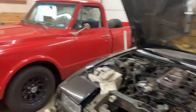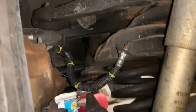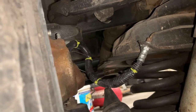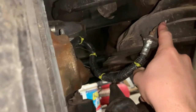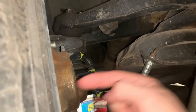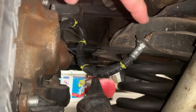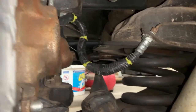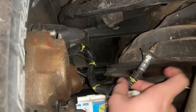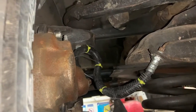It's been months at this point since the last clip with the brake lines, and I had to mess with that a little bit more, but I think I got it decent. What I think the deal is — why this was such a struggle — is that the trucks that had drum brakes like this one and the trucks that had factory front discs had the brake line in a different place. Because this one had drum brakes, I think all the ones with drum brakes had the brake line back there because it went straight to the drum. The ones with factory disc brakes had that same metal line on the front of the crossmember. I saw a truck from another guy who had factory front disc brakes and his brake line was on the front — so that's my theory on that.